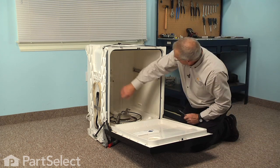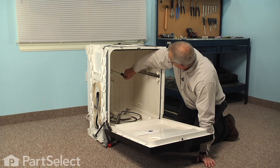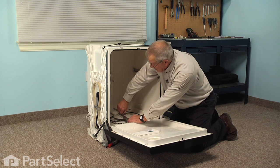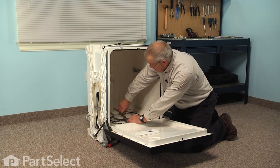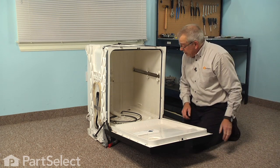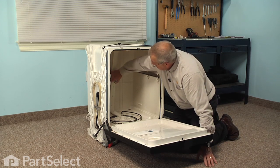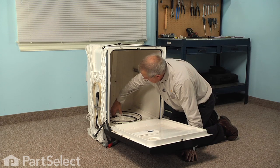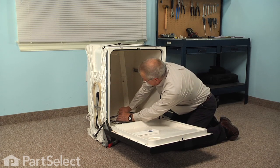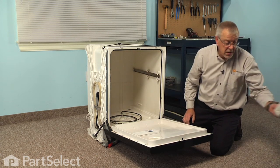Next we're going to remove two screws that secure the back manifold — one at the top and one at the back of the tub. These are Phillips screws, so remove those. Next we can remove the lower spray arm: grasp the spray arm and twist that center locking nut clockwise until it releases. Lift the spray arm off and set it aside, then pull that manifold down from the ceiling. Tilt it a bit to the right, lift up on the base, and rotate it clockwise until it disengages from the hub at the center. Then carefully lift that whole assembly out and set it aside.